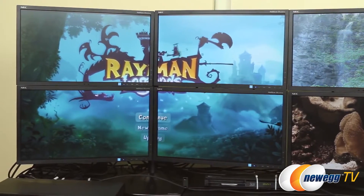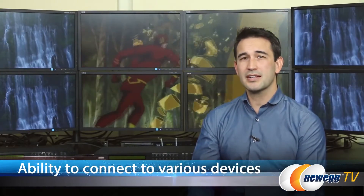If you had something more professional in mind, you could also do large scale keynote style presentations with one of these, sort of like the ones you'd see from major corporations. My personal favorite use of the switch is to set up multiple inputs for live streaming — that's exactly what I plan on doing with one of these. You can set up multiple sources like gaming PCs, cameras, tablets, or consoles, connect them to the A10 8x8 switch, connect a monitor and capture device to switch outputs, and with some configuration via their web GUI, you have a multiple input switch for professional-grade live streaming.